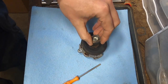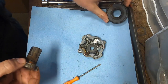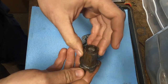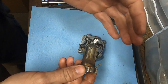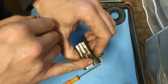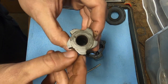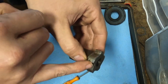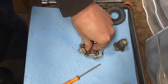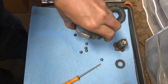Removing the top piece can be a little tricky, especially if the person who disassembled it before put it on incorrectly, smashed the screen down, or if it's covered in rust. We will clean this part, but it's not our primary piece. What you actually want to inspect is the bottom section. If there's a lot of pitting or big chunks missing — this should have a predefined edge — and this one is pretty good. If these are completely rounded, there's no point continuing: you need a new clutch. They're not that expensive.